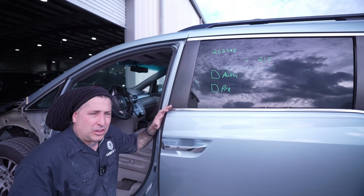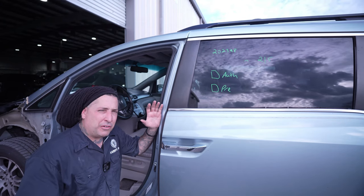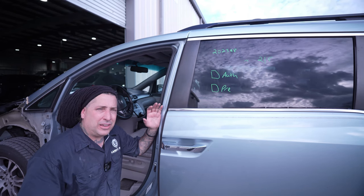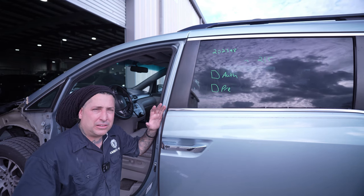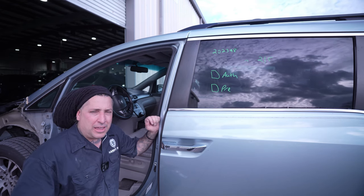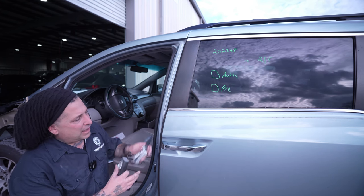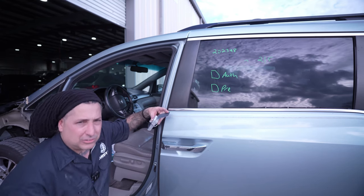Because in the business, usually the chips that I have or my spray-outs are going to get me very close. And if not, I'll go ahead and color tint as I'm mixing my actual paint. That way I can get my color closer because I'm very familiar with the strength of the toners and what these toners do. So let's go ahead, we'll mix up our paint, get painting in the booth, and start to tint this color around to get a better match than what we obviously have here, because this would never work on this job.